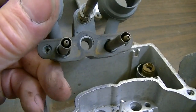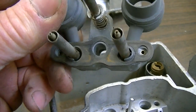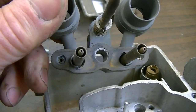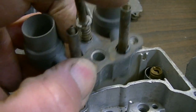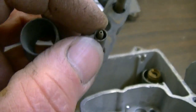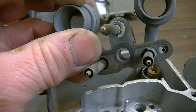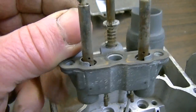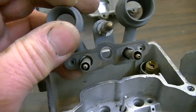You've got your bleeds for your idle there and your main air bleeds. You've got your orifice right there in your idle pickup tube that gives you your idle fuel. You can adjust them - you can drill them slightly larger - but the bad part about these carburetors is it's hard to go back once you go bigger. So you better make sure you need to go bigger, and you better only go in about thousandths increments.